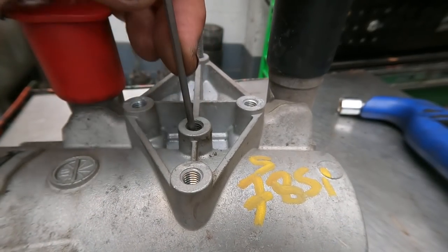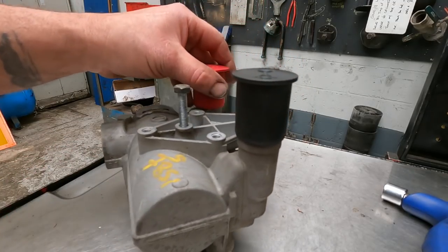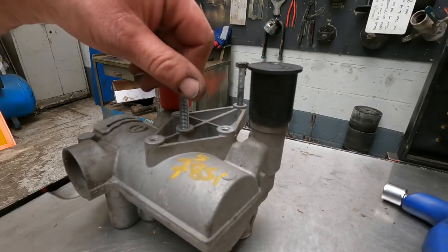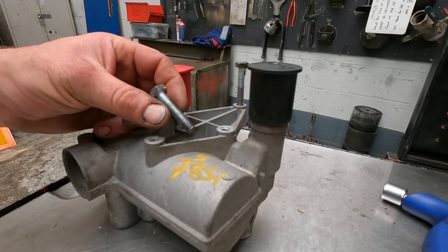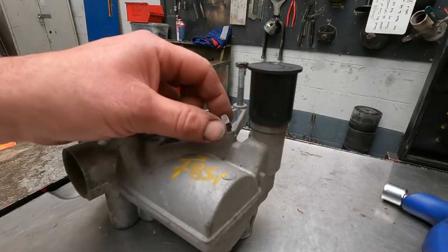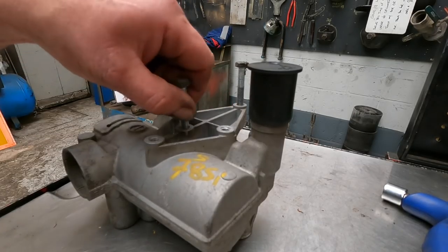That is incompetence from somebody - we can't trace who'd done that. This has been fitted and there's no history of it. We have a history of everything we do in our workshop and across our dealership, so not a good one at all - very, very dangerous. Moral of the story is: guys, check what you're bolting into on your valves, because if you put a long bolt through a valve, sometimes it'd crack it, and it could be a life or death situation.